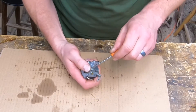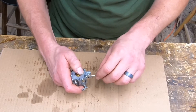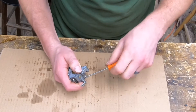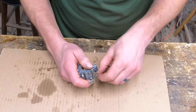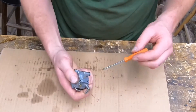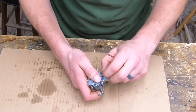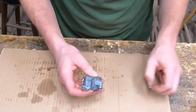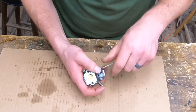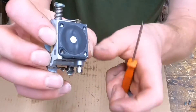My carburetor is ready for some work. Starting at the top — undo these little screws with a small flathead screwdriver. Mine came with one of my chainsaws from the dealer. Any small flathead or Phillips head screwdriver should work — they need to be small because these screws aren't huge. Now, in doing this there's a chance you may need a carb kit because you might rip the seal that's in here. If that happens, you're done until you can get a carb kit, so just be careful and take your time.